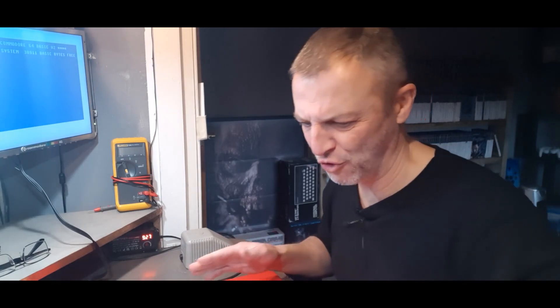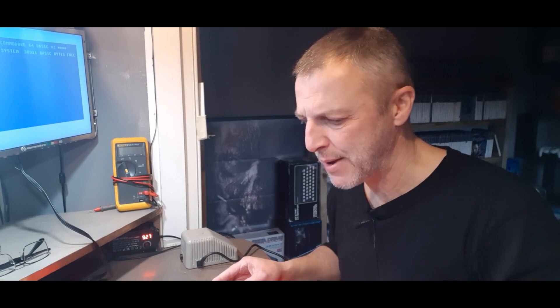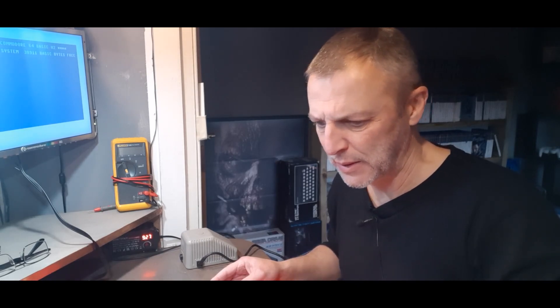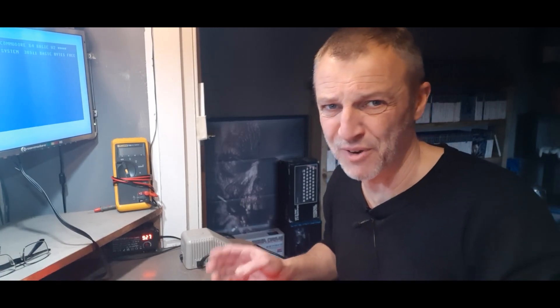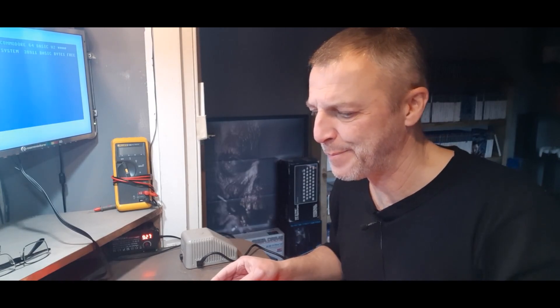With it being sealed you'd probably get an extra hundred quid — ish. I can clean it without opening, but that's only cleaning the outside — that's not really restoring anything. Not that it needs restoring. But if you're going to restore something, don't just clean the outside — you've got to open it up and clean inside and recap it, or whatever if it needs recapping. Don't recap it if it doesn't — it's pointless. So I can't really call it refurbished if I don't open it.